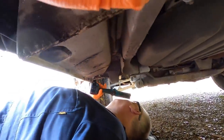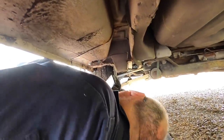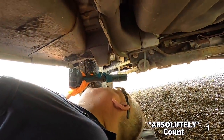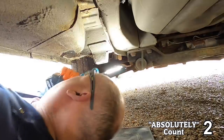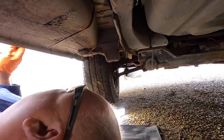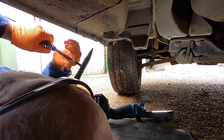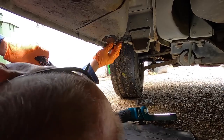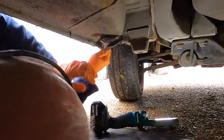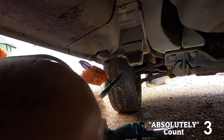So that's the near-side front. What do you see, Chas? Well, in front of the front wheel, from the front crossmember back over through the wheel arch through the tunnel where the suspension sits — absolutely solid. There's a little bit here on one of the jacking points, but if I give that a tap — see, that is solid. That's only the underseal coming off, so we'll pull that off. You don't want water getting trapped.